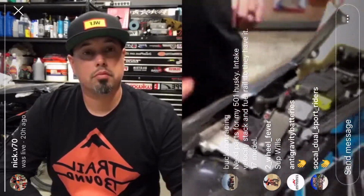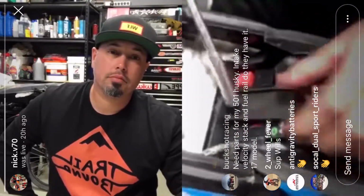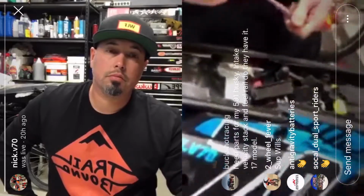They have what's called restart technology. Basically, it has a reserve cell in it, so if you leave your key on, which you've done, the battery has a cell on reserve that doesn't get used normally. What you do, if Riley wants to show right here, is pop this little cover off, this little holder for the battery, and press this little button right next to my finger. Then you press your start button, and it will have enough juice to start the bike. And when your bike is running and while you're riding, it'll recharge the rest of the battery.